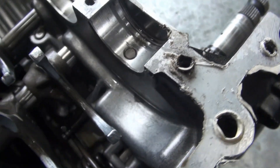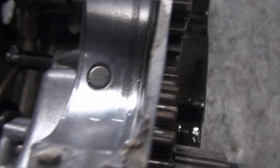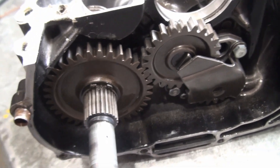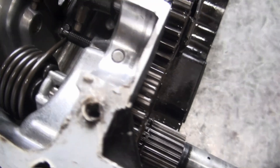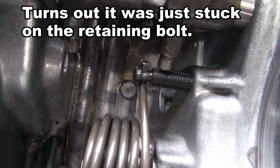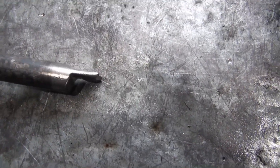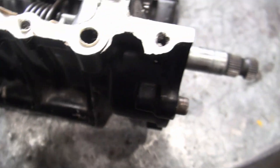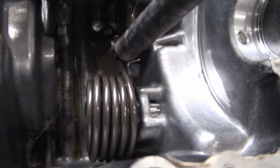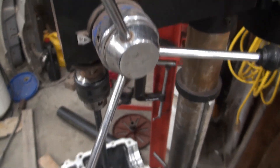That's the bulk of the problem, I think, so I'd like to get that pin out of there — possibly push it out from the bottom. To do that I need to remove this kickstart shaft assembly. That spring is really stiff; I tried to disengage it pressing with a screwdriver and it was very difficult. I thought maybe a homemade tool using the drill press could press it off — but it turns out the spring was not that stiff after all.